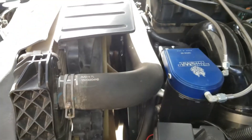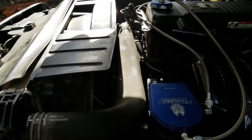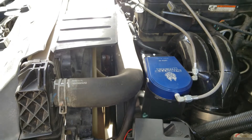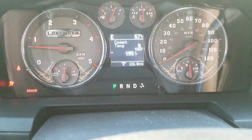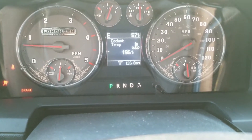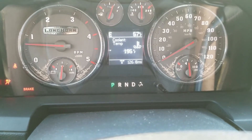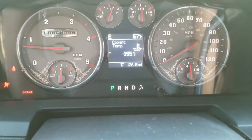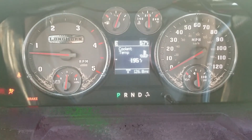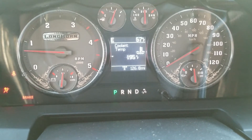There is a solution for this. We're going to get everything out and laid out, and I'm probably going to end up changing that thermostat to a 180° T-STAT because this truck is deleted. With the 200° thermostat and 57 degrees outside, it runs between 190 and 200 while driving. Dodge had a tech tip that you could change these thermostats to 190°, but seeing as it's deleted and tuned, I no longer need the high temperatures, and that's why we're going to the 180.